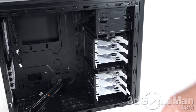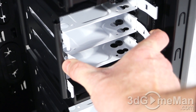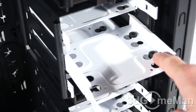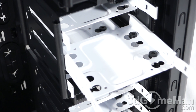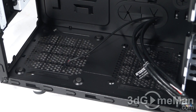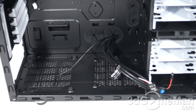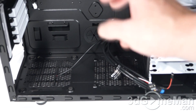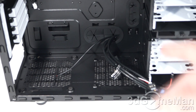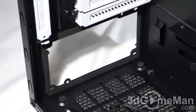Both cages can be removed and you can install up to three drives in each, whether they be 3.5-inch or 2.5-inch. To install a 3.5-inch drive, just pinch on either side and slide it out. This is a metal drive cage so it's not flimsy. They include rubber grommets when installing a 3.5-inch drive to prevent vibrations. Expansion slots don't have a tool-less design either, but they include thumb screws on all of them. At the bottom there are four rubber rests for the power supply. You can install an optional 120 millimeter fan here, but power supply length will vary: with the optional fan installed, up to 170 millimeters; without it, up to 220 millimeters.